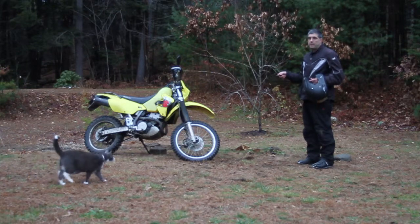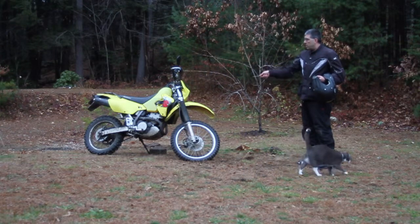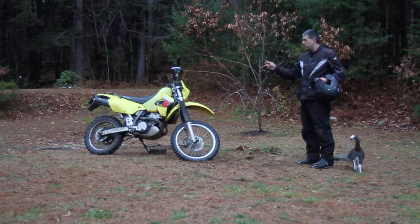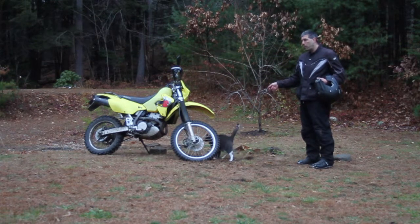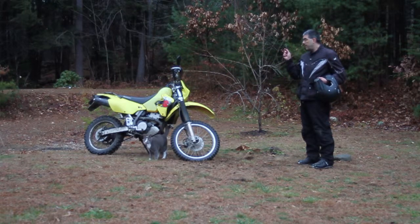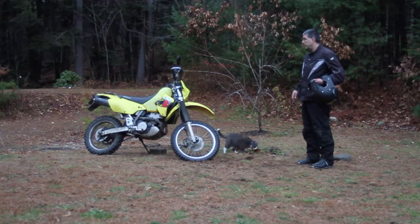Another video that I'm going to make, maybe incorporate it with this one into a third video, is the new shocks that I've just purchased for this bike. I've got 2002S series forks, forks that have the rebound adjustment on them up at the top. This does not. This is a damper style fork, really much cheaper and a lot less adjustment and a lot less versatility than a cartridge style fork. The set of 2002 forks that I have is cartridge style. So you'll be able to see the comparison between the two with different settings.